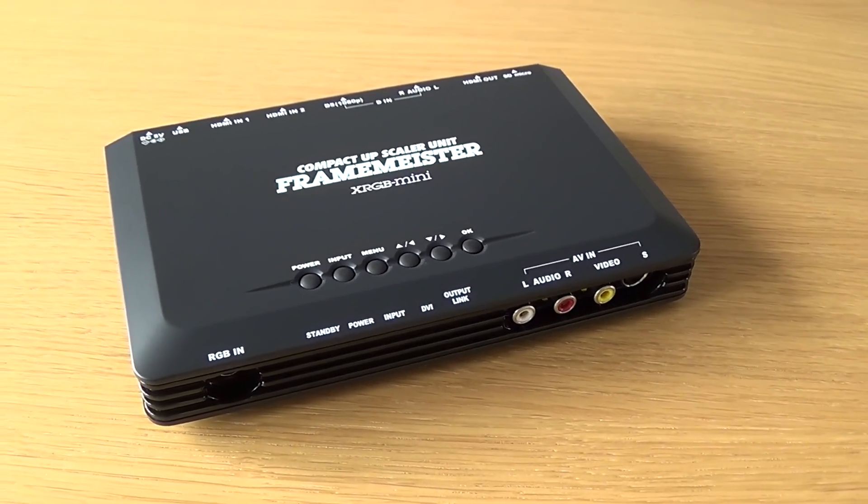Next is horizontal width. You can see that white line on the left, just between the light blue and black — it's annoying. If you're playing a game with a black background, it becomes a big fat vertical white bar. To get rid of it, go to horizontal width — it says 32, you want to put it to 34. And it's gone.